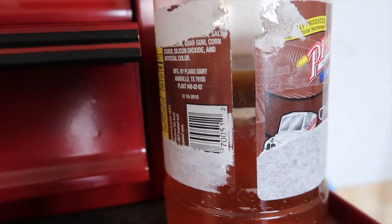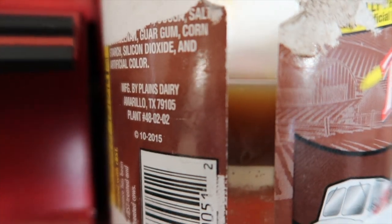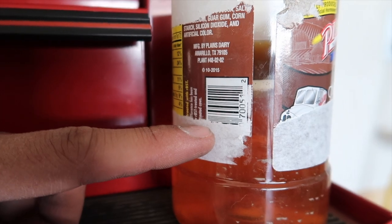I forgot to show you guys — I went and checked my catch can yesterday and that thing was full, so I had to hurry up and empty it. This is what was in it — better than last time when it comes to the water-to-oil-and-junk ratio. It's mostly water and I'm assuming fuel on the bottom, then some yellow junk mixture. The catch can is doing its job. Can't wait till summer to really see how much it collects — it won't collect as much water in winter because the cold-hot cycle creates moisture and that's where it's getting trapped.